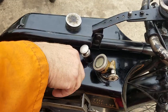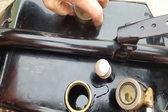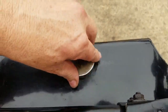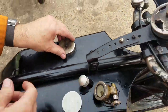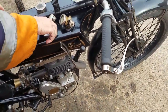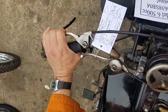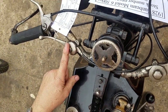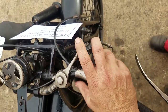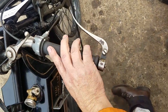This side's the oil tank — there's the fuel. The tank looks like it's been sealed; it's the petrol the bike came in with, we haven't put fresh gas in it. And then your handlebar controls: valve lifter, clutch, advance and retard — so it's fully advanced, tight wire advanced. This would have been the throttle, I presume. It's nice that he left the lever on there — twist grip. Looks like he's been getting the running right with the carburettor.